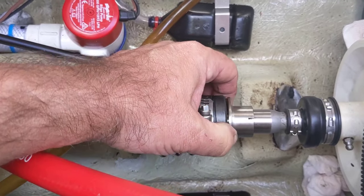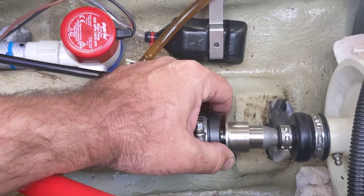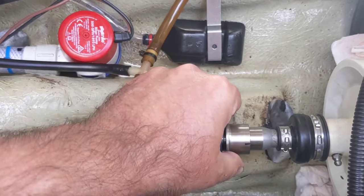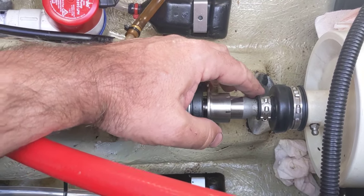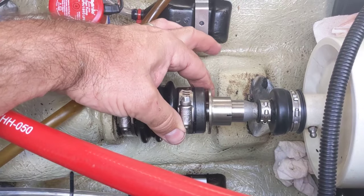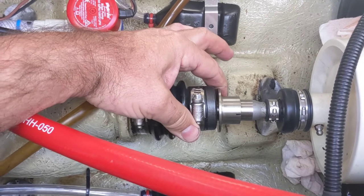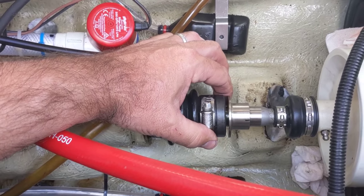This part slides a little freer now, so it'll be able to slip along the shaft. Now we have to take this clamp off of this boot so the drive shaft can come out of the engine. We'll take the pump out and pull the drive shaft straight back.